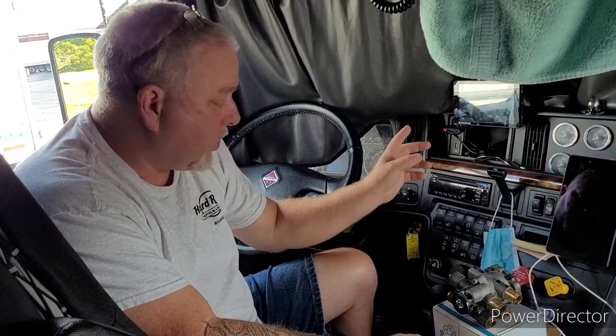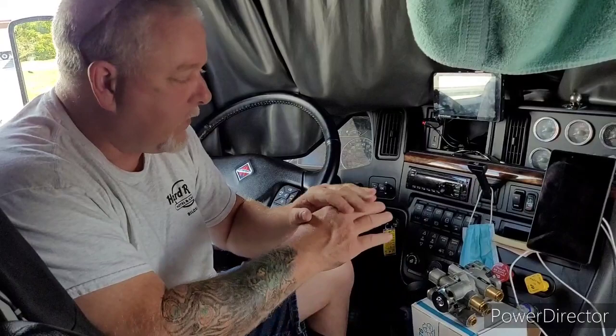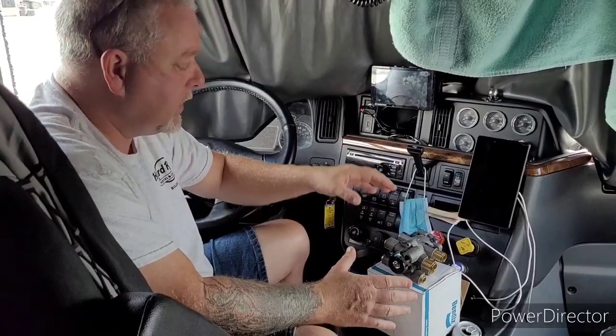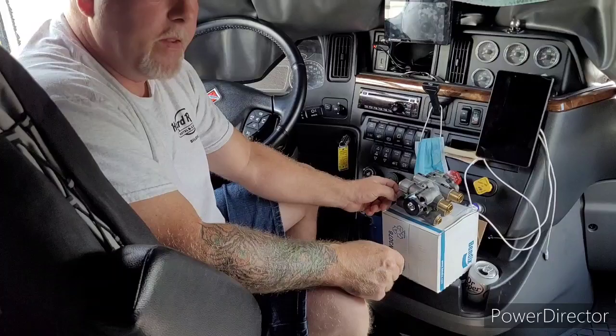That way air doesn't have to travel all the way from the foot brake valve all the way to the brakes — it makes the system work faster when activating the brakes. So this line that dropped down to the bottom of that T — when you pull that line off, there should not be air coming through it. If it's a delivery line, you should never have air coming back into this valve when everything is off. When I pulled that line off, sure enough I could plug it with my thumb, actually engage the front brake chambers, and when I let off you could hear and feel them release.